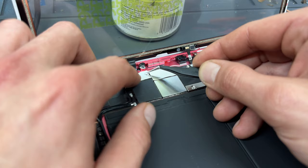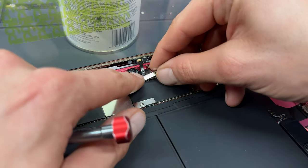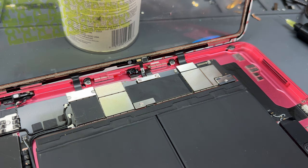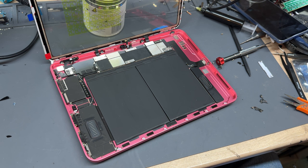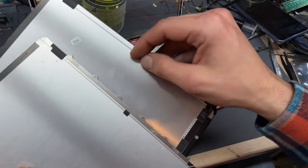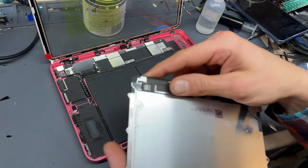I'll pop something weighted behind it and re-secure two out of the three shields. Starting with this one shaped like a razor blade, I'll secure the two crosshead screws. Then the shield for the microphone and front camera — place that down and re-secure the two crosshead screws. All the crosshead screws holding down these flex cables are the same size, so don't worry if you mix them up. The only ones that are different are the LCD screws and the battery screw. Now we need to get our new LCD out and ready to install — I got this from iParts4U for about £170 for non-trade members.